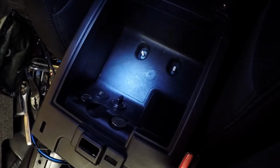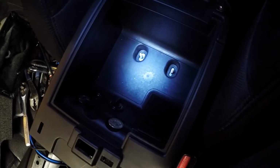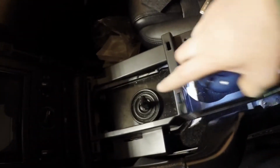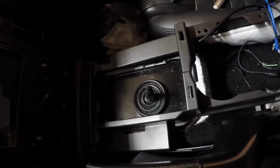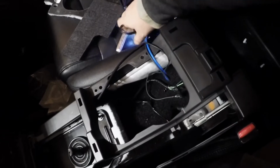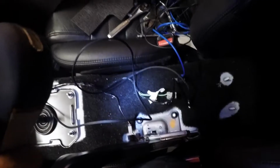To also get out the center console, there were two 10-millimeter bolts in the back there underneath the carpet. And then, like I said, those two 7-millimeters that were up there. When you're trying to get out this shift lever, you want to actually hold on to the shift lever while you're cracking it, because those do have quite a bit of tension when you're popping those out, so you don't want to scratch up your panels or smack your nav screen. Once those screws are out, your console lifts up from the back, and then you slide it out.